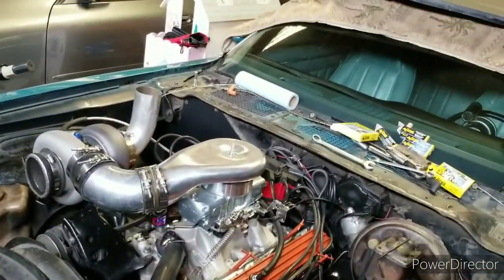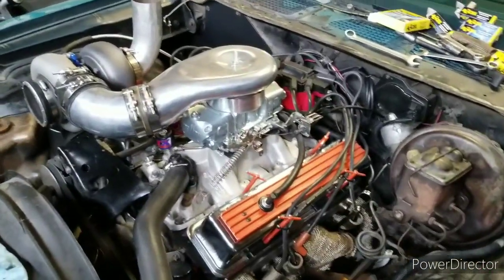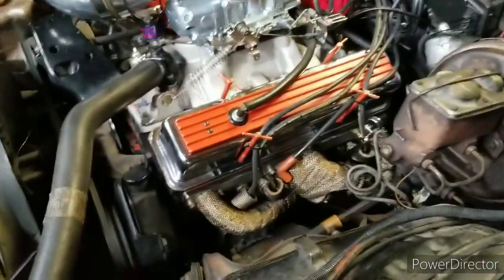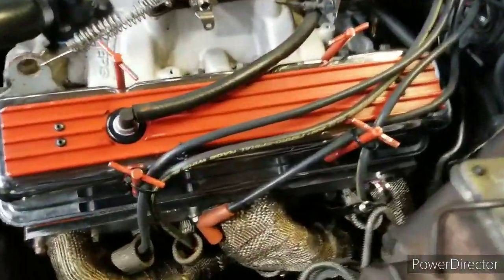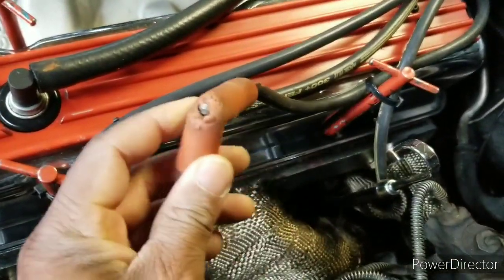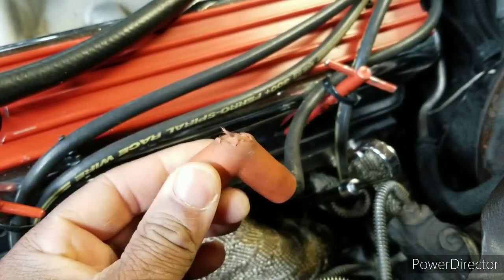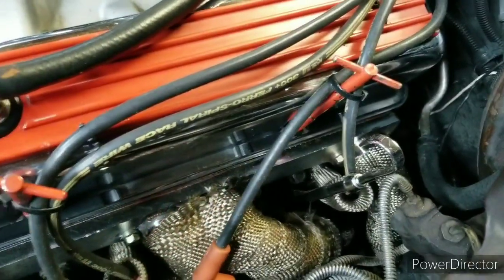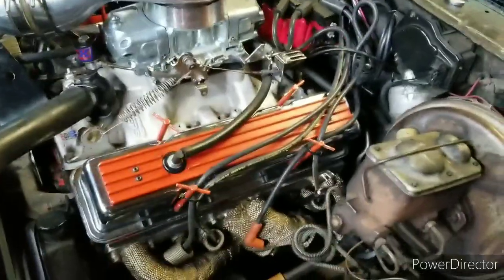Last time we chatted I took this car out for a ride and it ran pretty smooth, but one of the problems I was having is I kept burning the spark plug — that's the spark plug on number five. That's not good, that's definitely a misfire. The spark is getting through the boot and going wherever it pleases instead of into that spark plug and down through the cylinder.